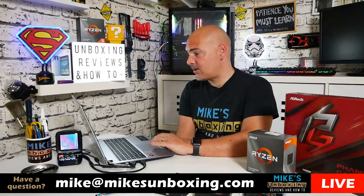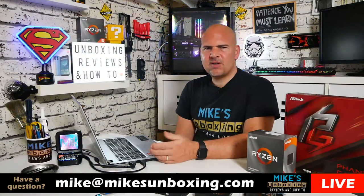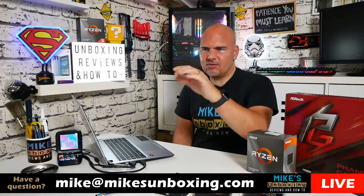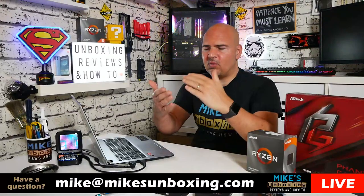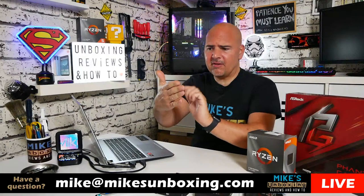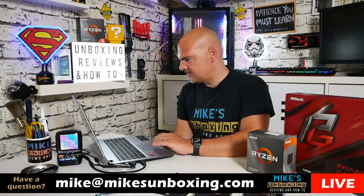Karitsu says, my chipset fan got pretty loud, possibly or probably because of the card blocking it. Yeah, that is always a thing. Like, why would you put a chipset fan directly where a GPU is going to sit? Because obviously, whenever you get a fan and you put something in front of it, you get turbulence and resistance, and the fan speeds up a bit to combat it. It's always a bad idea.